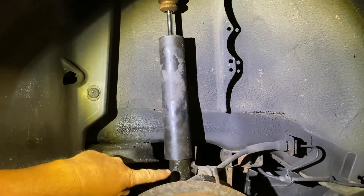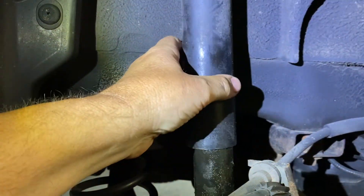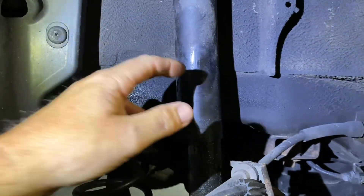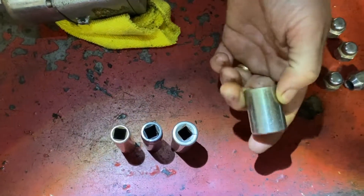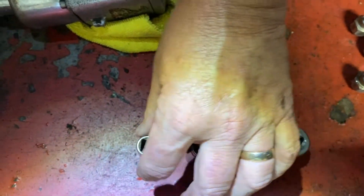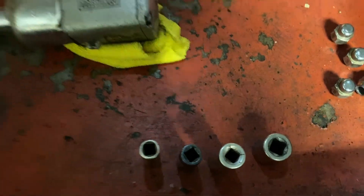As you can see, this one is totally blown — that's a telltale sign with all the wetness, all the fluid leaked out of it. I have it loose, and like I always do, I explain how to replace it. It's very easy. All you're going to need is a 21 millimeter to take the lug nuts off, a 17 millimeter or 13 millimeter, and a 12 millimeter deep socket, impact wrench or breaker bar, whatever you want to do to take the wheel off.